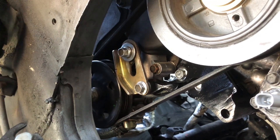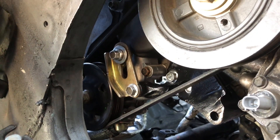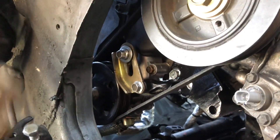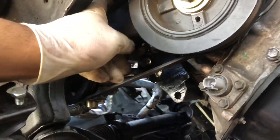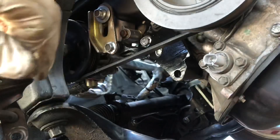1MZ power steering pump converted to 3MZ — that's going to be the title of the video. So there you guys have it. In case you guys are switching over to the 3MZ on your Solara, Camry, whatever it is, you guys now have a video for it. And we've rotated a couple of times — the belt does clear from everything, so we're good to go.